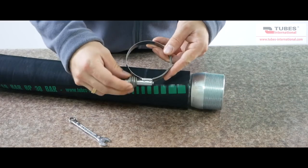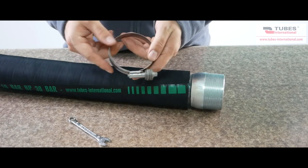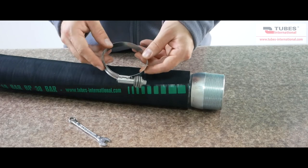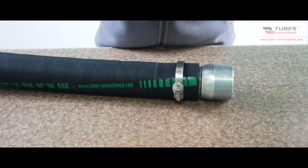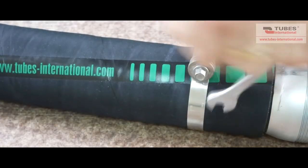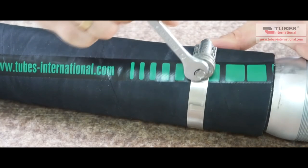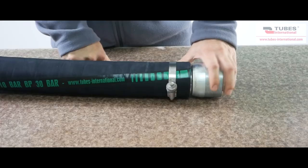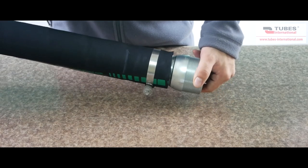The last clamp example is a flex gear clamp. It's a band clamp with a spring-loaded lock which maintains a constant tension. It's suitable for applications where temperature and pressure fluctuations occur. The liner with rounded edges protects the hose cover from damage and ensures a uniform tension over the entire circumference. All you need to install it is a right size flat spanner.